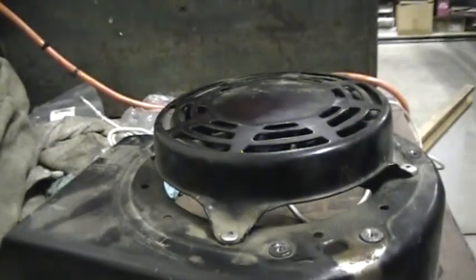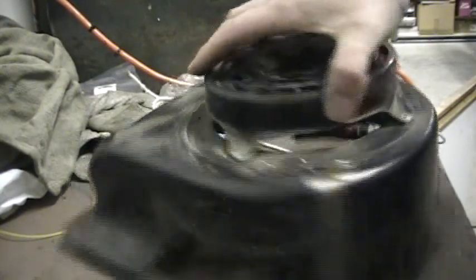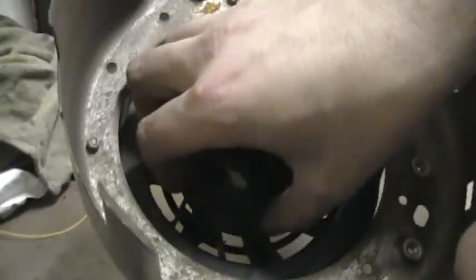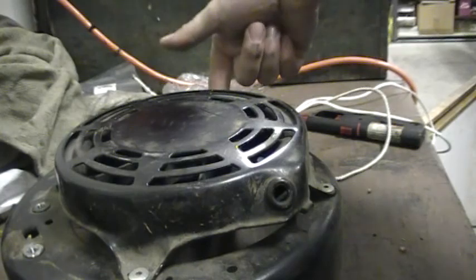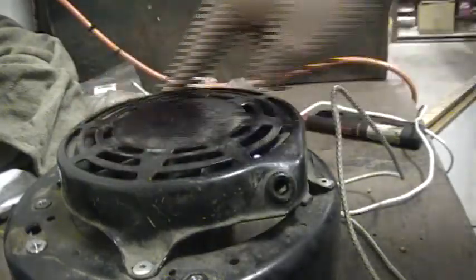Starting out here. This is the second starter I have for my lawn mower, because the first one had the spring break inside. You see this bolt here — you don't want to take this out because the piece will come off and the spring inside will just go springing out. You need a lot of patience to rewind that spring. What we need to do is determine the direction that this thing goes. This being the front of the mower, the hole right here for the starter cord means that when you pull it, this turns clockwise. So when we turn it upside down, we know that it will turn counterclockwise.